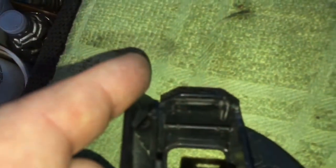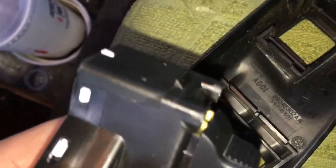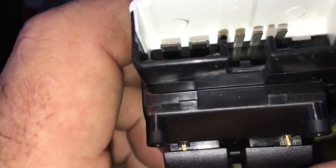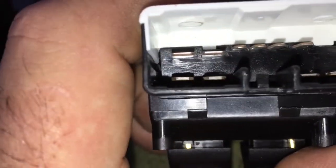When I put this new switch in, it'll go in at the front. There's a divot right here — that front divot is for the front part of this switch. The front part of that switch will go in there, then the back is supposed to snap in right there. See those little nubbies — that little nubby in the center of the screen and that one — those two little nubbies are where the switch clips.